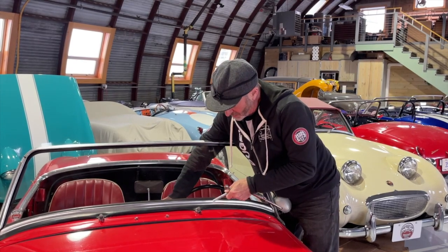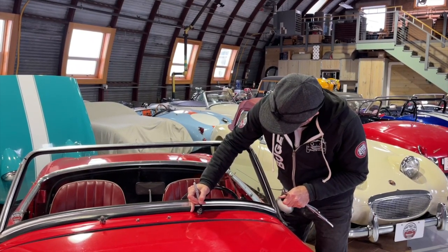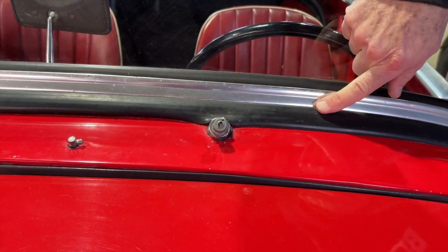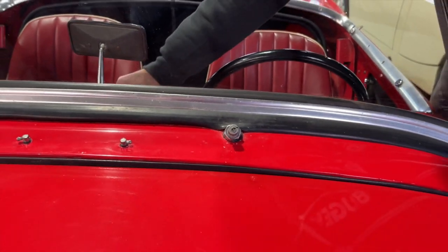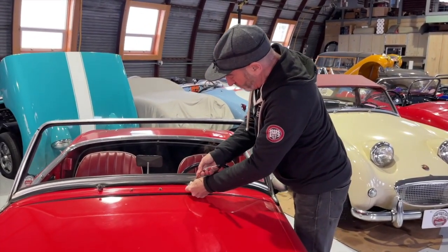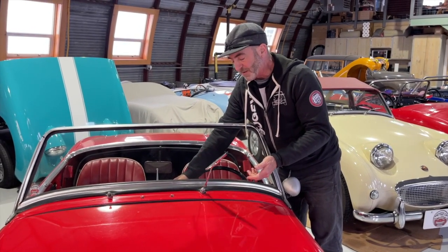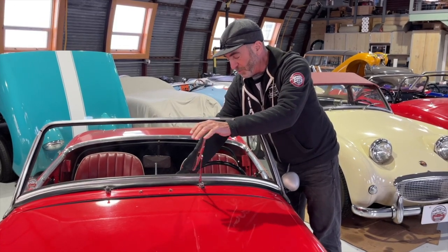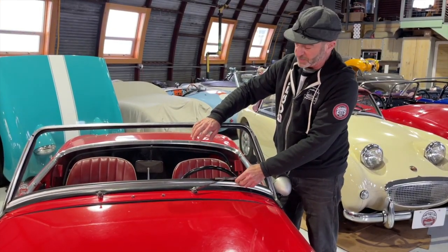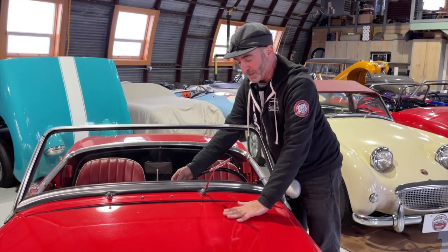So right now, I'm going to turn it off, and it stops right there. And I'm going to draw with the Sharpie, this is my angle. You should be able to see that. And now when the motor moves, you see how it stops right there, it stops right here. That's the throw of the little gearbox. So when I turn it off, this one doesn't park. But I'm going to line it up like so. Now, when I turn it on, it's in the proper orientation because I've checked it. And now I can, with confidence, put it back down on the glass, and again, I'm trying not to run this on dry glass just so I don't scratch the glass. But now I know that I've marked it, and that if someone, my passenger or whomever, turns on the blade, it's not going to scratch the cowl.